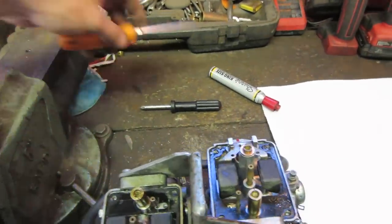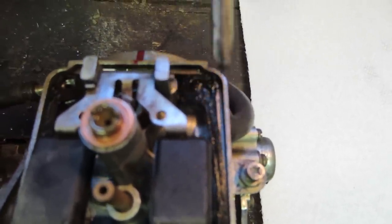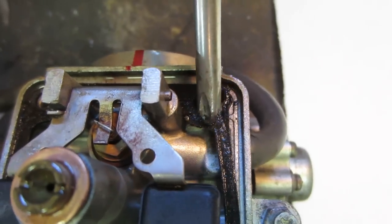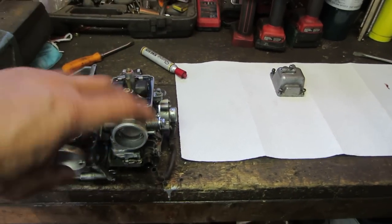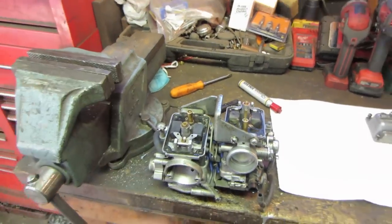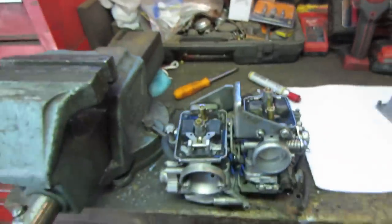I just wanted to show what was wrong inside the carburetors where they were leaking. You can see that one right there is broken off right here and pushed back together — I was trying to tweak it back into place and tighten the bowl down, but you can see daylight behind the gasket, so that's right where it was tweaking out. The new gaskets will take care of that. I'm going to disassemble them — one's marked with a red magic marker so all that stuff will go on that side and everything else on the other side, because you end up flipping around and lose track of what's on which one.